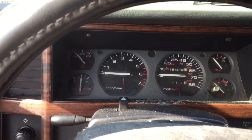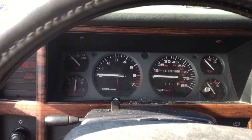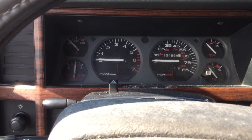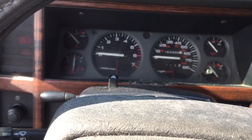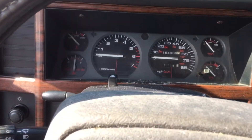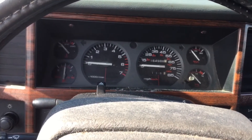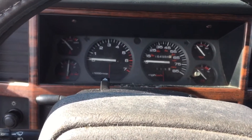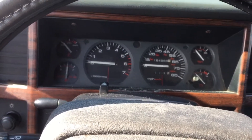Let's start off and watch the dash. Notice we got no RPM bouncing and no bulb check. The check engine light isn't coming on when you turn the key on, which it should do for a few seconds. The customer brought it in thinking he might need a fuel pump, but it doesn't have fuel pressure, it doesn't have spark, and it doesn't have injector control. So if he had thrown a fuel pump in it, he'd have been wrong — good thing he brought it in here.